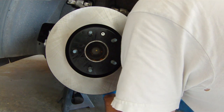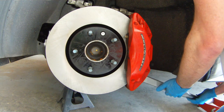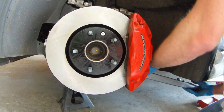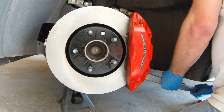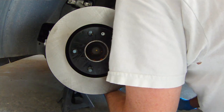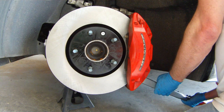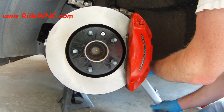Again, I'm not going to tell you what that is because your car might be different from mine. Do check your manual or go online and check what the torque specs are for your particular car. I'm going to tell you that the number is greater than 150 foot-pounds. And I'm under 50 years old, and getting a torque wrench onto these bolts and torquing it to the spec that GM requires is incredible, and it was very close to kicking my ass.